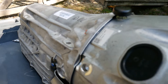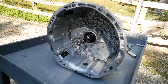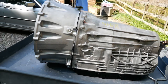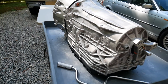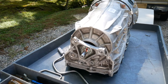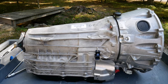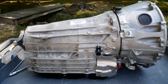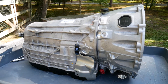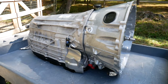Just like the 7G-Tronic, the 9G-Tronic features an aluminum-magnesium case with a conventional aluminum bell housing. All fasteners that thread into the aluminum-magnesium case are aluminum — even the retainer for the parking pawl and parking mechanism. The aluminum-magnesium case normally quickly oxidizes and takes on a bluish-gray color. This is a very late model vehicle, so it hasn't been exposed to the elements. However, humidity caused the interior of the transmission to oxidize, while the exterior resists. We suspect Mercedes uses some type of clear film coating to help reduce oxidation of the case.